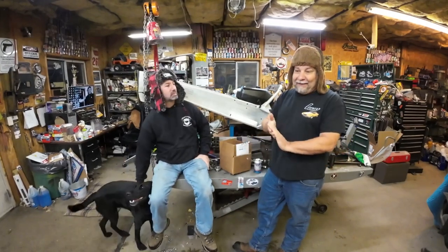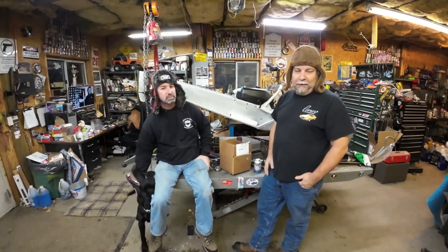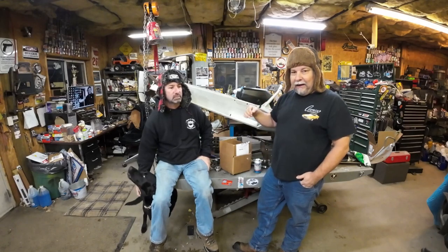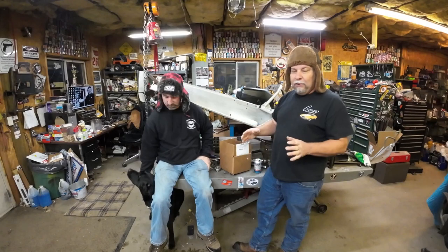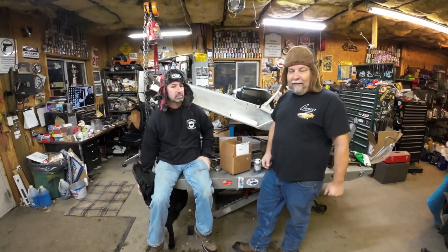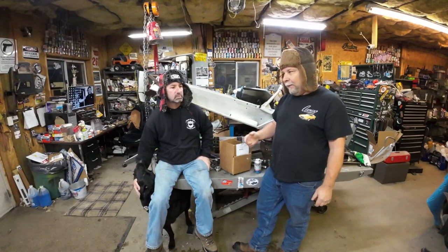So, basically, the plan for tonight is to just keep going on this. I got to get that jack shaft welded up so I can get that absolutely finalized. I can know if I need to shim my chain case or anything like that. And then I can lay out the drive shaft. So that's my plan.